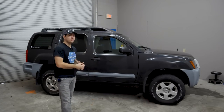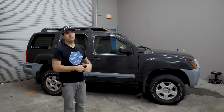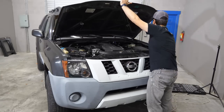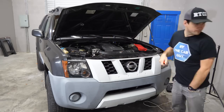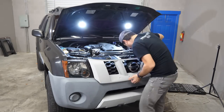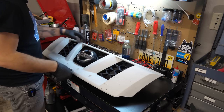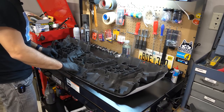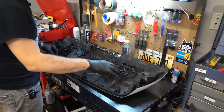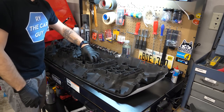That means I have a ton of work to do, so we're going to start by taking off the front grill. I'm just going to buzz through that since I already have a video on it — I'll put it as a recommended video on screen and in the description below. Here is our grill. You can disassemble this more — if you flip it over, there are plastic clips. As long as you're careful, since these get brittle over time, you can disconnect the honeycomb from the frame and take the emblem off.